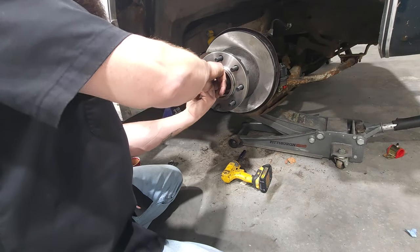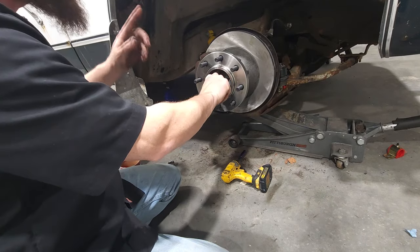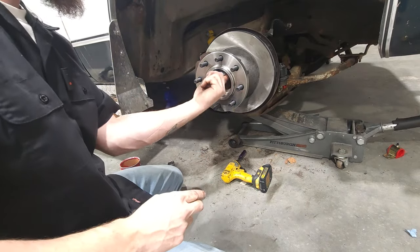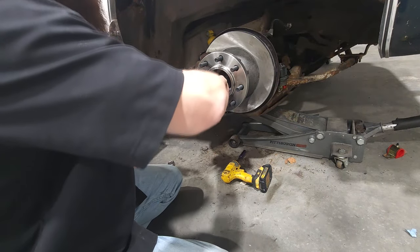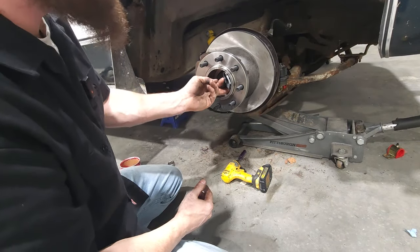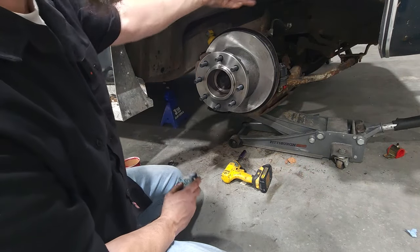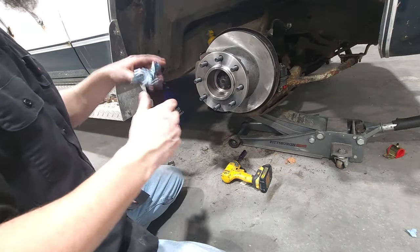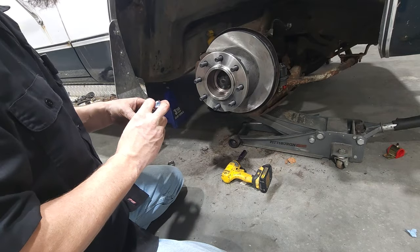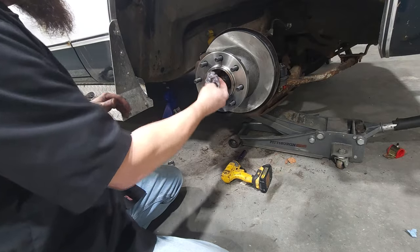And it's tire time. This side is done. Now, I still have to put the inner tie rod, hit the bolt on that. My plan there is just get that when I do the front sway bar bushing. Which, you know, I'll show you guys how to put the front sway bar bushing in, where I showed you how to do the side ones. It's the exact same thing, just a different location. And well, inner tie rod, same thing as the outer tie rod. Push it up in its taper, lock the nut down, tighten it up until it doesn't tighten no more, and put the cotter pin in. There you go. That's how you do it.